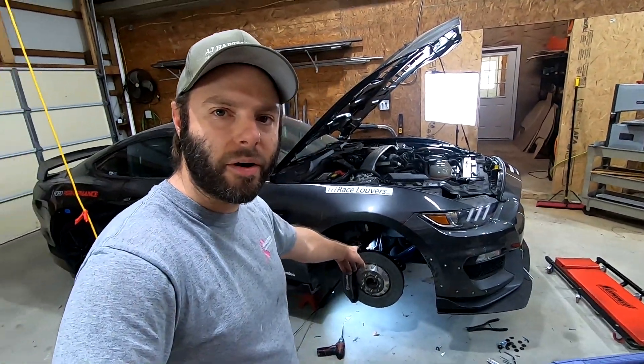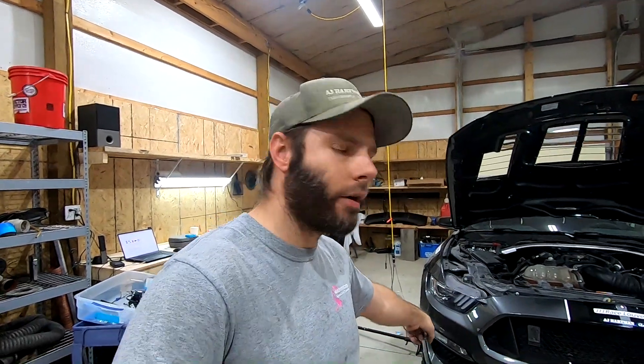This was a quick little easy one. I hope you enjoyed seeing a little bit of the process on a more simple part, unlike our air box lids. These air curtain blockers will be on the website and will come with the hardware and everything. Installing — my car is up in the air because I'm doing some other stuff to it, but you could probably just turn your wheels to the left and do the passenger side, turn the wheels the other way — don't even have to lift up your car. The gain from these is small; it's one of those things where little bits kind of add up. You will make a little more downforce supported with our wind tunnel numbers — we're not just making that up. Also a little bit better cooling through your heat exchangers, simply because you're putting a little more high pressure in front and a little less air is spilling into the wheel well, giving you just that little bit more low pressure behind it. Link to these will be in the video description below. Thanks for hanging out and I'll see you in the next one.